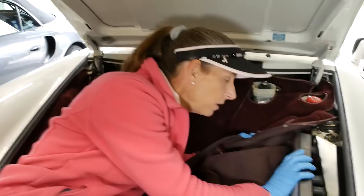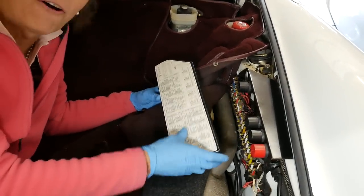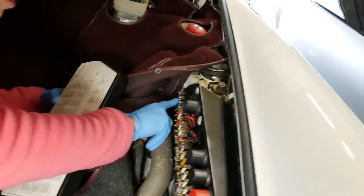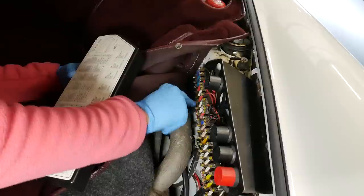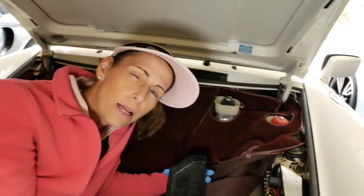So we just go ahead and open our fuse box here. This is kind of confusing the way this whole thing is set up, but it's fuse number six — one, two, three, four, five, six. This one here is a big 25-amp fuse. So we're going to go ahead and pull that out. That should be a lot safer if we ever end up turning on the ignition without thinking about it.